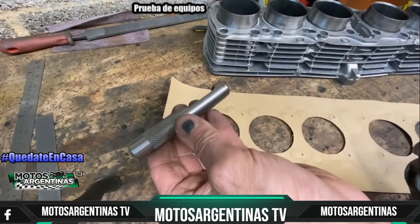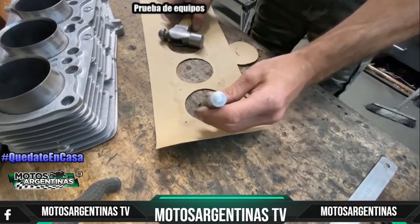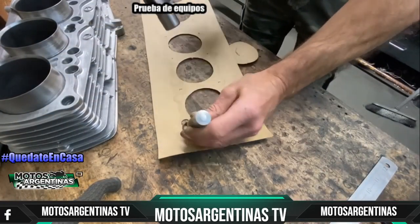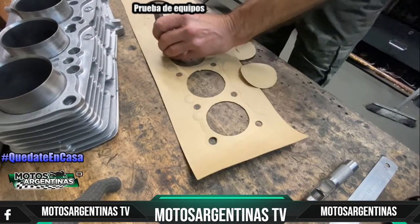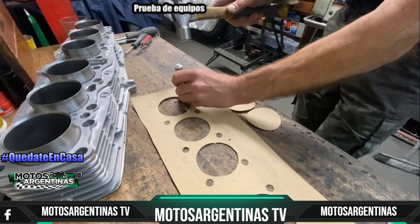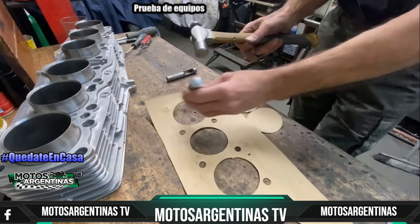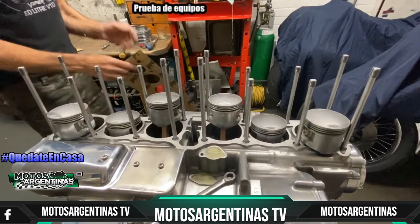Before I cut out the gasket, I use my hole punch to punch the holes where the studs are going to pass through. With the holes punched, I just thought I'd try it onto the engine because there's a lot of studs and it slips on lovely. I'm well pleased with that.